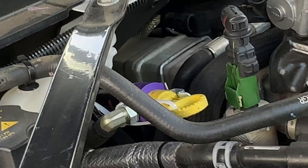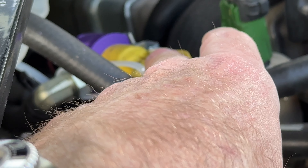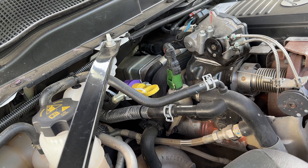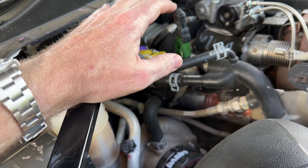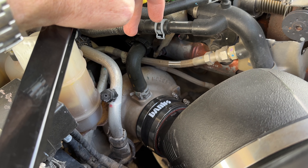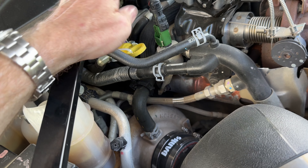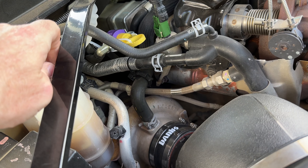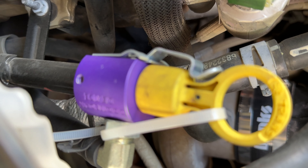This is not a Banks item — I'll put a link to this thing. There's a recall on the Rams right now about the transmission. The issue is that your dipstick will come out and drip. Your torque converter will boil over from over-towing, getting too hot, and then it'll spray transmission fluid right down onto the boiling hot turbo and catch your truck on fire. This is a recall and they haven't come up with a solution. These guys — non-affiliated, I'll put a link in the description — came up with this locking thing. It literally just locks your dipstick into place.